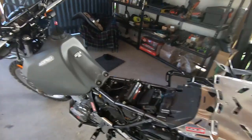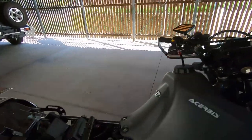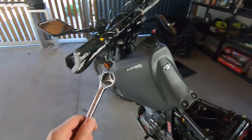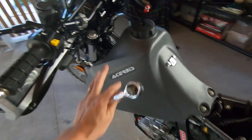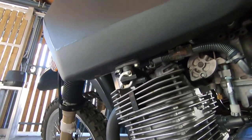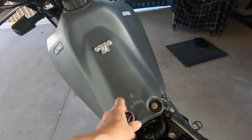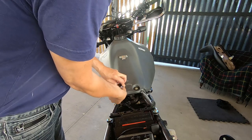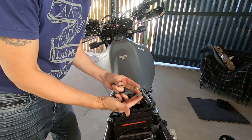As is normally the case, the bolt here is pretty hard to get a wrench in. So time to strip the bike — took the side panels off, the seat's come off. I'm going to have to remove the tank anyway to loosen all the cables and give them a bit more reach for the new bars. So I've disconnected the pipe, caught the excess fuel, and I'm going to undo these bolts and pull the tank off.